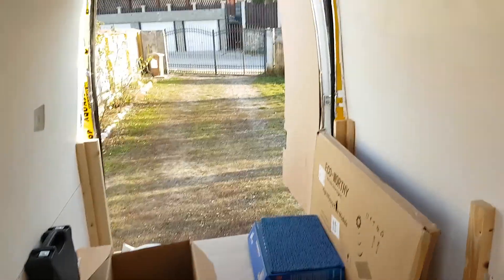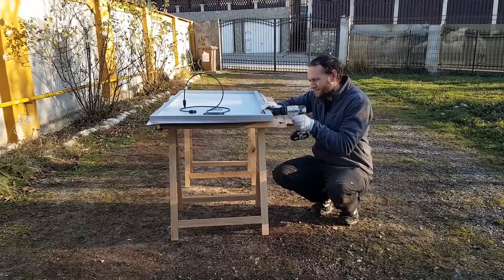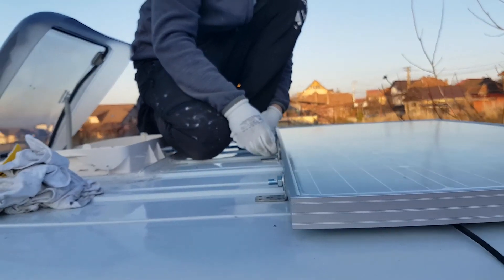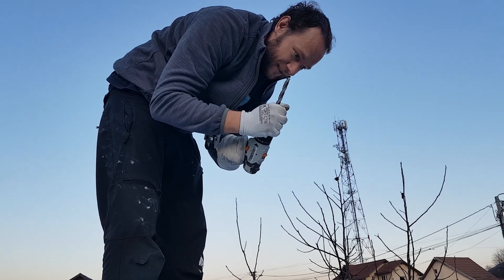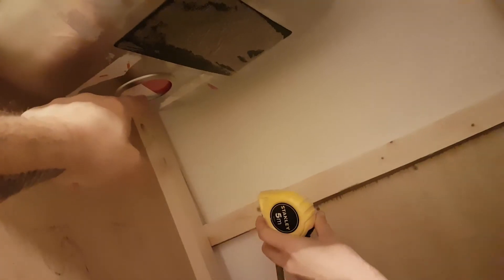Solar panel time. I'm marking out where our panels are going to go. It's because I put the bloody washer on the wrong side — washer goes on the outside. This is where our water jugs go. Drain water into one water jug. Foot pump. We'll take water from one of these jugs, up into the tap, behind there, down into the waste.